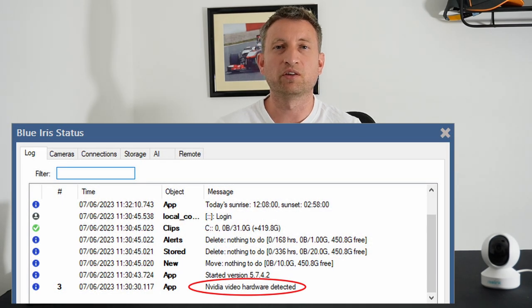I would recommend installing this on something like an Intel NUC or a spare PC. The reason for that is that then you can use the integrated hardware acceleration of either the Intel processor or a dedicated GPU, because then it will make the footage a lot easier to process and not put all the strain on the CPU. I currently do actually run it in a VM and it uses the CPU, but it definitely makes the Intel NUC struggle a little.